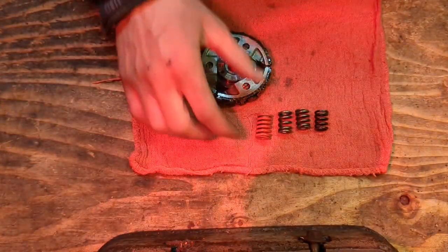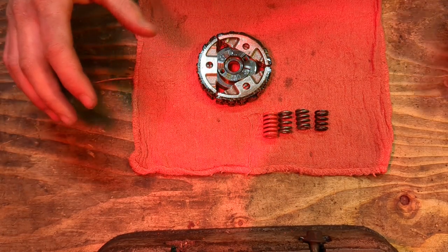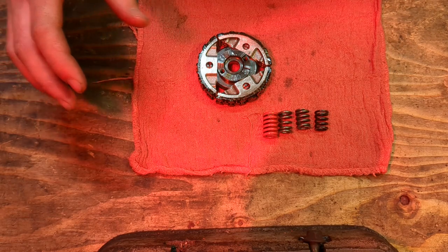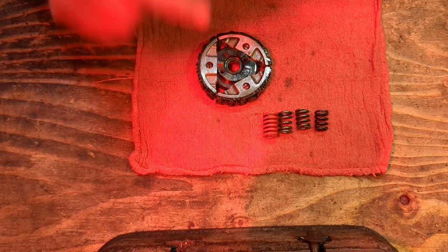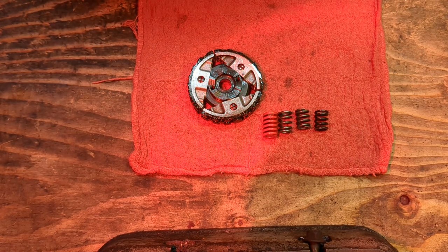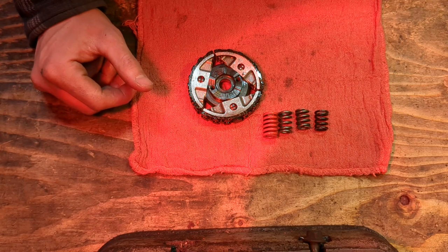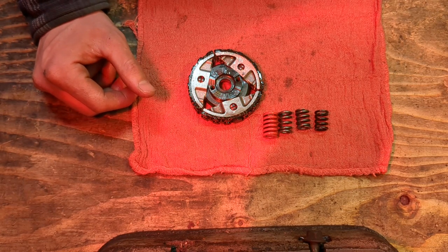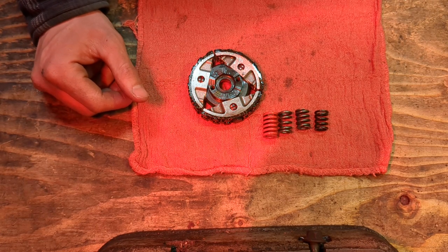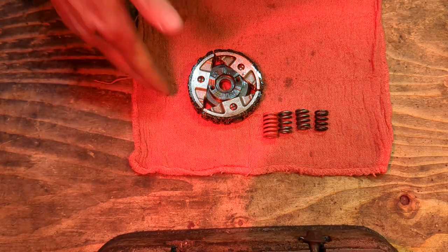Right now you're seeing a custom spring. We'll get into that in just a minute. But so the SX junior senior washer stack version works, but it is not reliable. You have to pull these things apart all the time and clean out those washer stacks and then restack them in a precise order in order to be able to put the power down. And that just gets ridiculous.